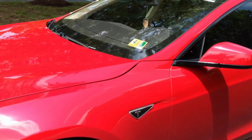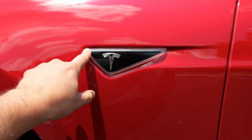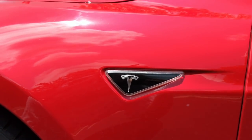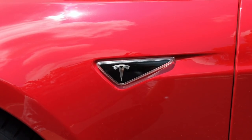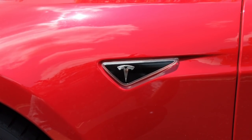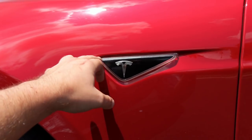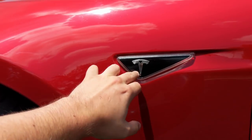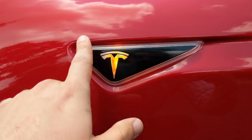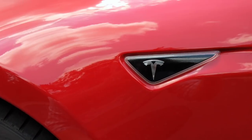Moving on to the side — the little turn markers here are super easy. Just take your vinyl, lay it across the top. It has a really nice edge that you can cut out with your sharp knife. One overall tip with vinyl wrapping: keep your razor blades super sharp, pop them off, get a new one. You don't realize how dull your blade is until you put a new one on — it makes such a huge difference. If you're pulling the vinyl at all while cutting, your blade is too dull. Cut right into the nice edges for a really nice shape.